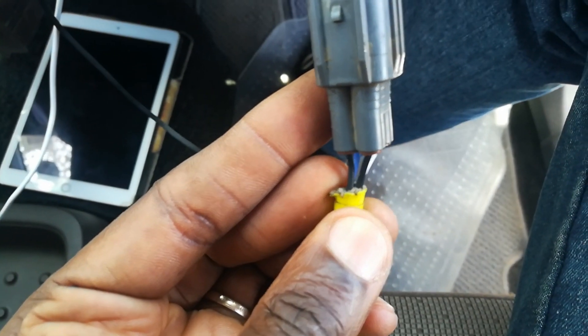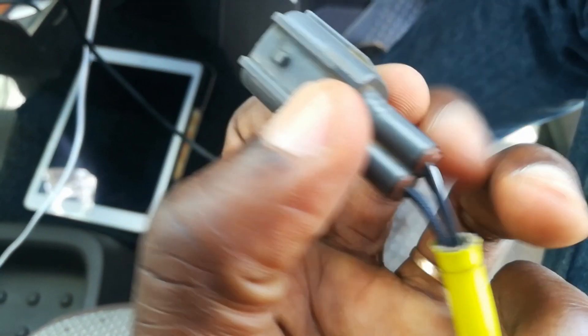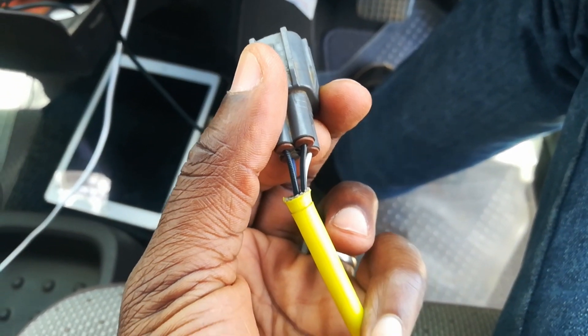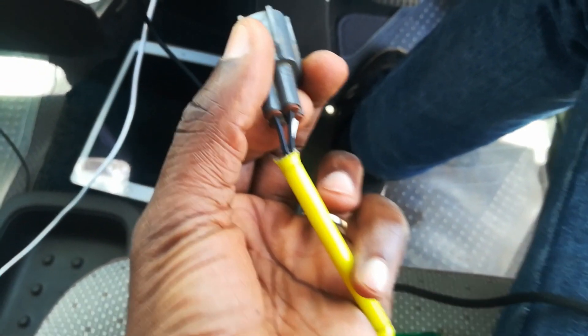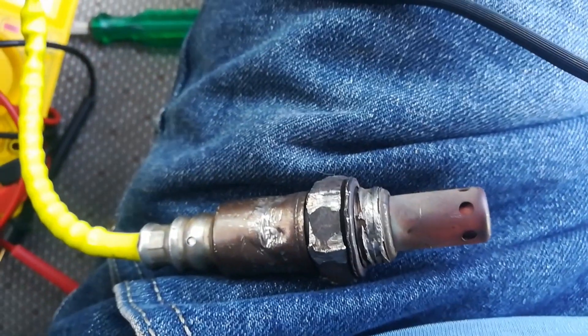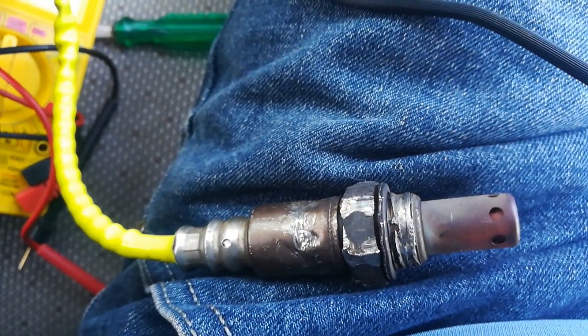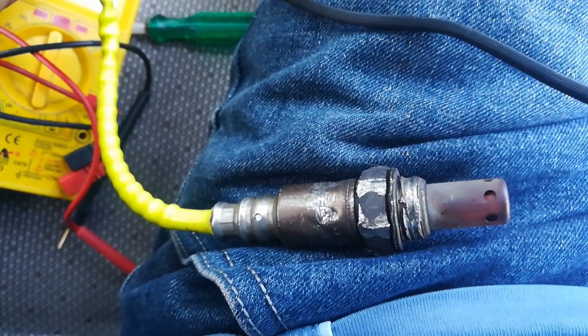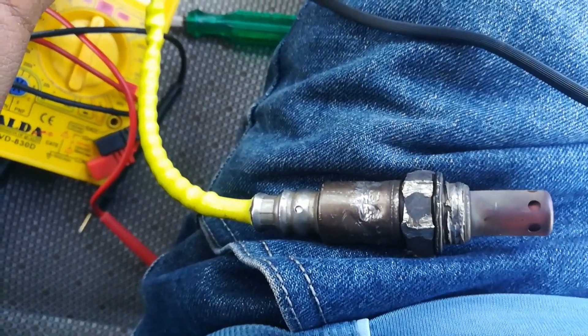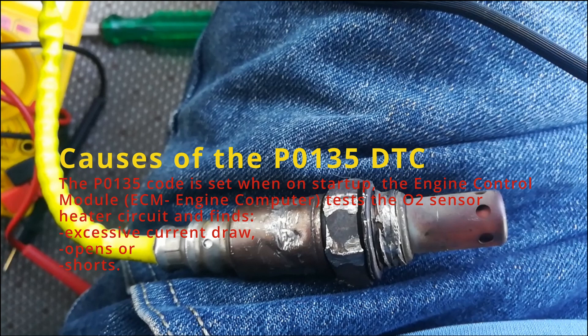The sensor has four wires, as you can see here. Two are the heater wires — in this case they are black. Then we have the blue and the white wire: the blue is the signal and the white is the return. The black wires form the heater circuit, which must be complete for the heater to work. These O2 sensors require a certain temperature to operate — if that temperature has not been reached, they will not give any signal to the ECU.